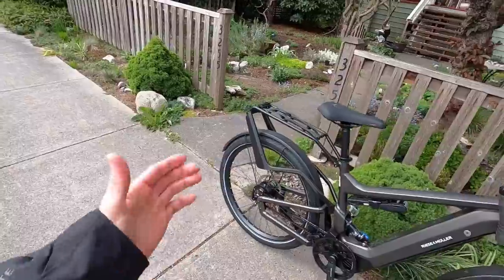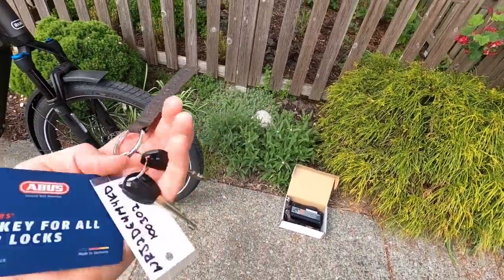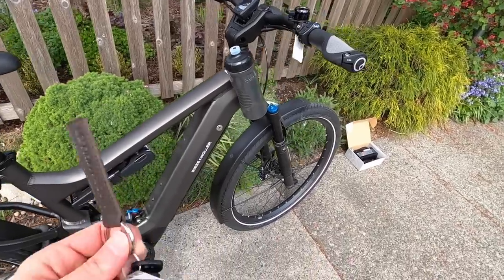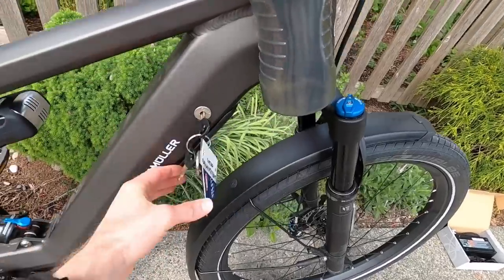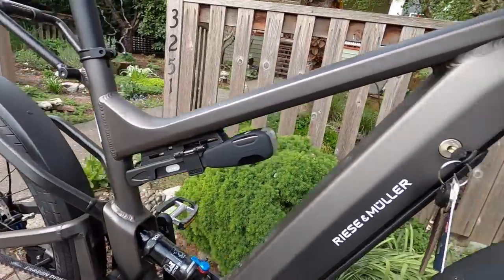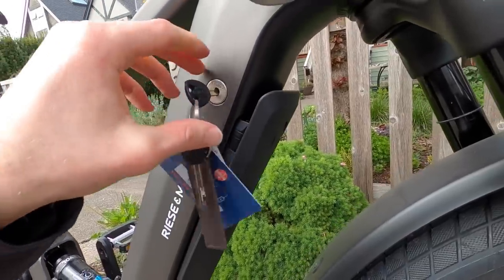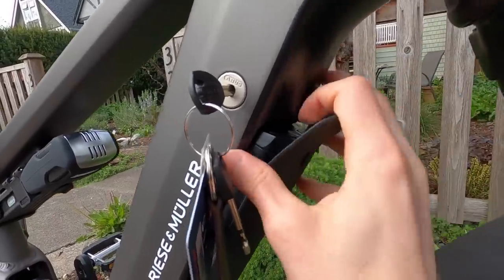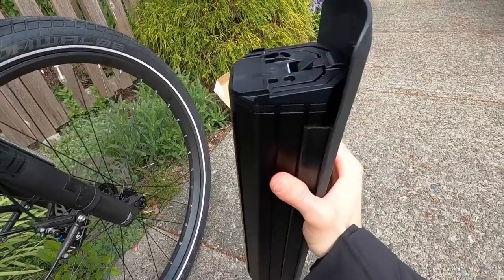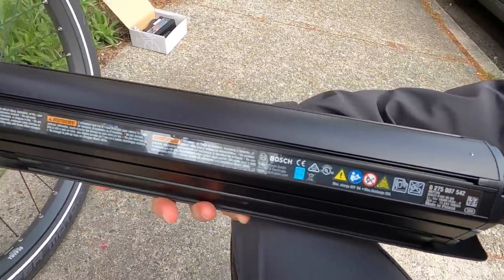I'm going to show you the battery removal. It comes with a great manual and nice leather accessories — the fancy sports car kind of thing. We insert the Abus Plus key, give it a first twist and the battery drops down smoothly. It doesn't come all the way out on its own — you have to reach in, press the rubberized cover, and push the battery out. It weighs 6.4 pounds just for the battery, 6.8 with all the covers — 36 volts, 13.4Ah for roughly 500Wh of capacity.